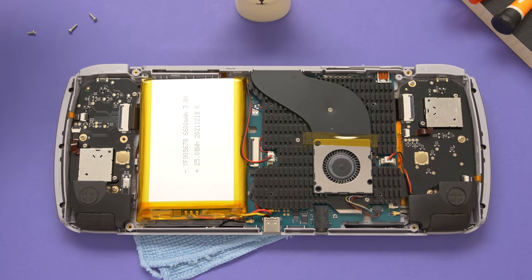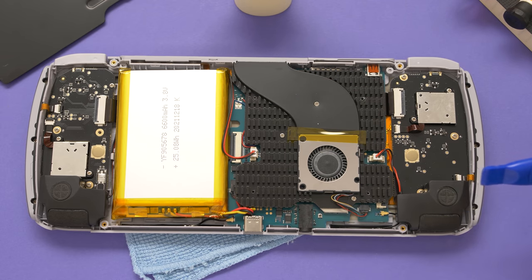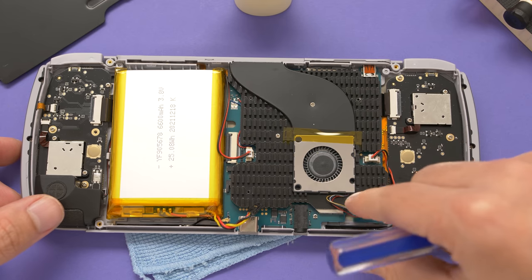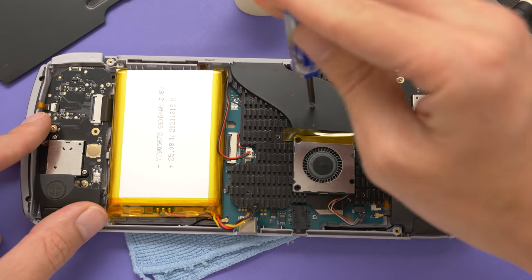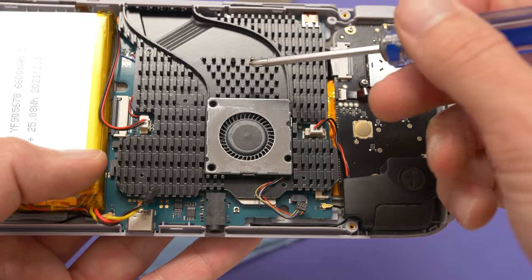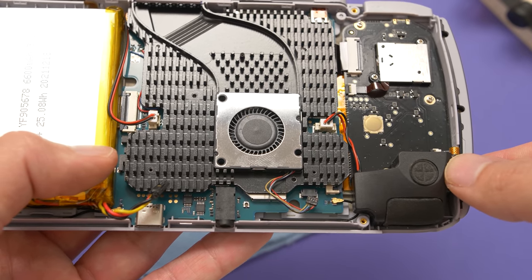This is a better look at the passive and active cooling on Odin. Near the middle, we have our fan with a tunnel to guide the air out to the top. This fan is plugged into the PCB and the speaker cable is routed around the top of the battery to the other side of the heatsink. Compared to the Odin Lite, there is a lot more going on here. After unplugging the battery cable and removing the heatsink, we can see the fan takes in heat from the back shell, blows it over these posts, and the air ultimately leaves through the top vent. The hottest heat source is where the processor is, so you're blowing air right over the top of it. It's not as good as having the fan directly on top of the processor, but that's just splitting hairs.